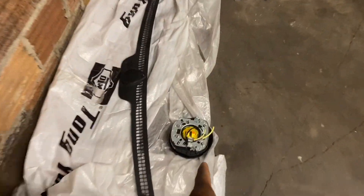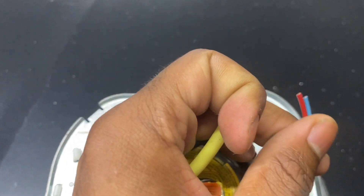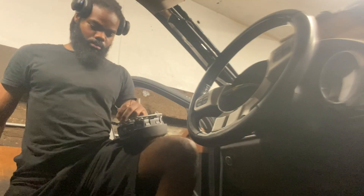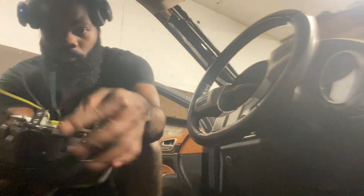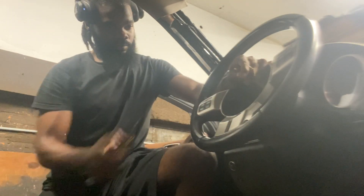Now we can tackle this airbag. I got some new connectors, so we'll do the same thing as last video — splice it, put the connector in, heat it up, make sure it's got a good seal, then reinstall. This right here is the brand new airbag. I already cut the connectors on this one since we need them. Basically we'll remove the insulation from each wire, take your time so you don't damage the wire, and once you're done it's going to look like this. Then repeat the same process on the steering wheel.